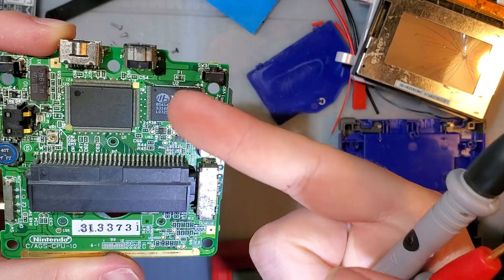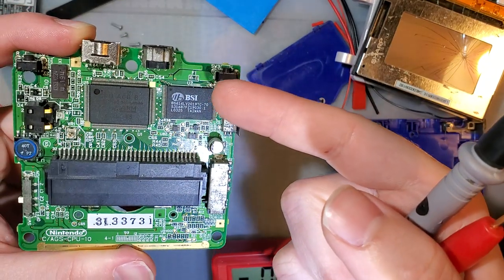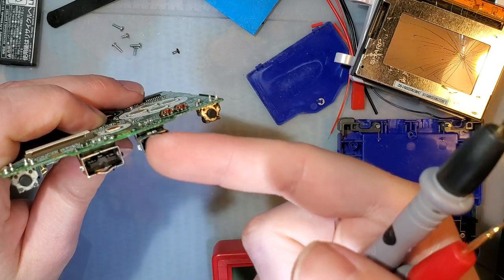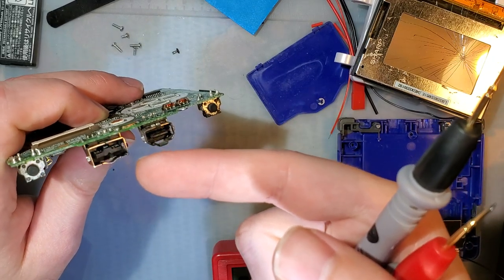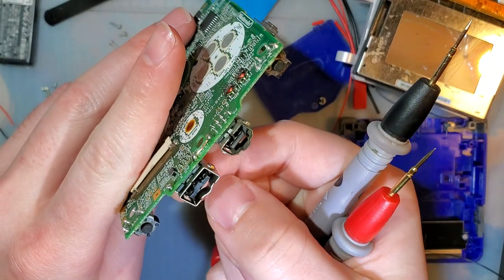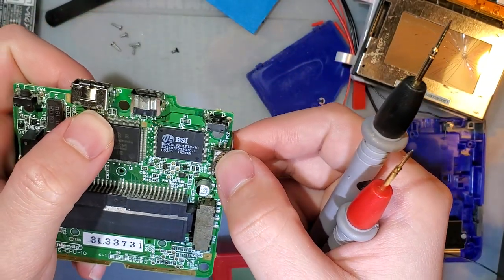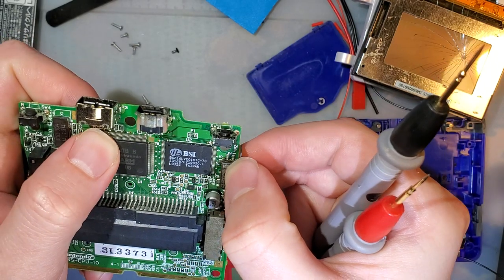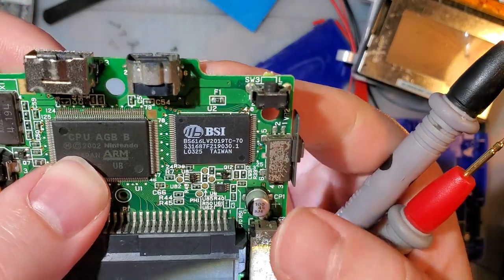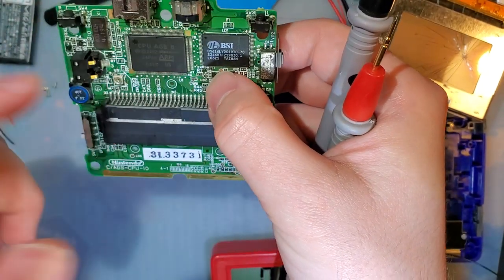This is the fuse that, if this fuse blows, it's going to detach the charge port from the rest of the circuit. The idea is that, you know, if the charge port physically breaks and the pins come in contact with one another, or the positive voltage pin comes in contact with the shielding or something like that, in the event of a catastrophic failure, it's to prevent something more expensive from breaking. Yeah, it is kind of a bummer because not everyone can, you know, get in there and solder that fine pitch component. But it's better than burning out the CPU, I think.